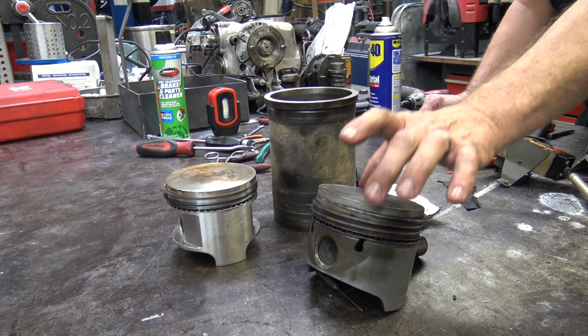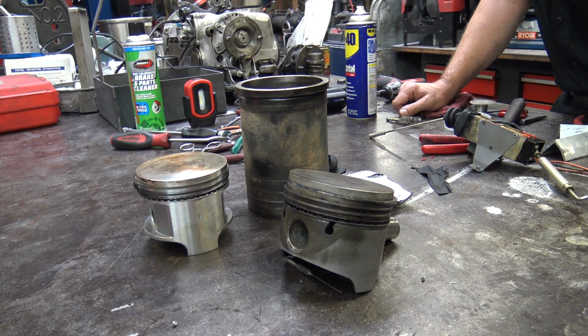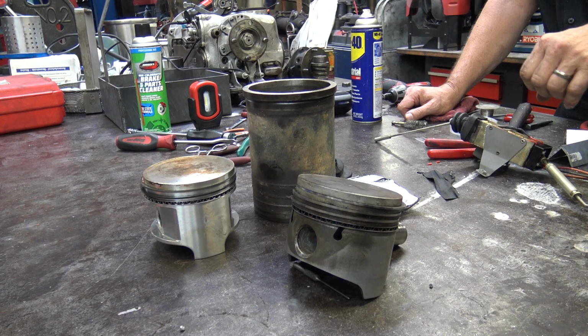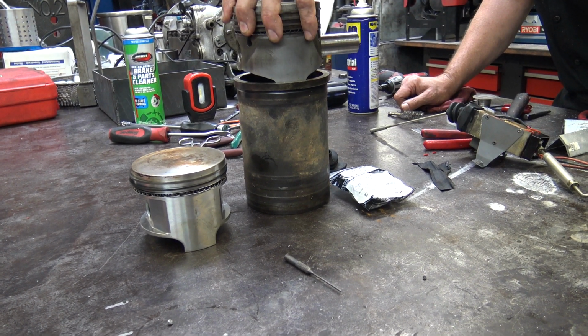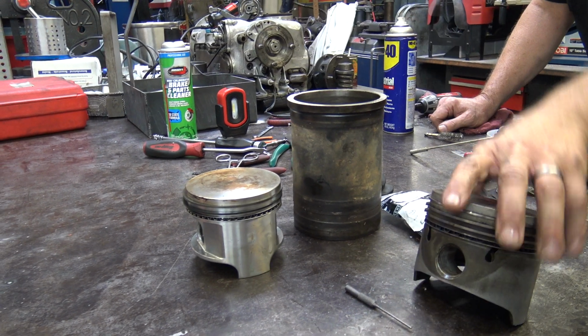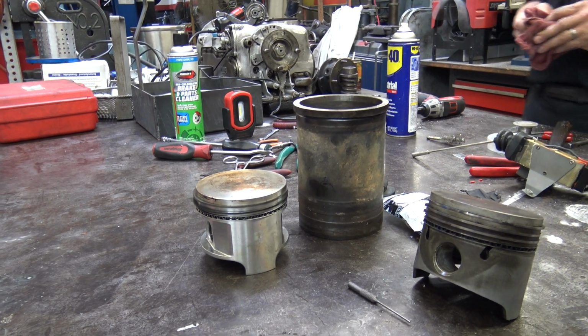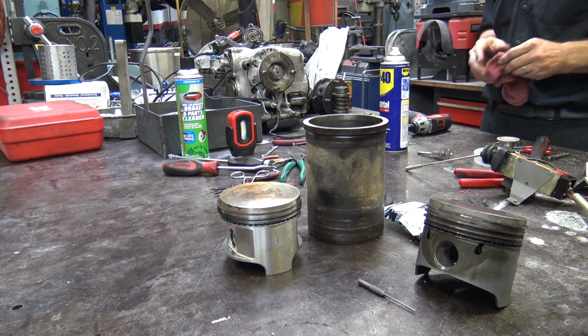This is 4.1 in diameter. That's the Rolls-Royce bore, 4.1. Cylinders, 4.1, almost zero clearance. Virtually zero. When you put them in, they're a little tight here. As you can see, this is pretty loose. This is a Chevrolet piston. 4.125, 25 thousandths bigger. Okay?